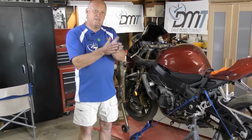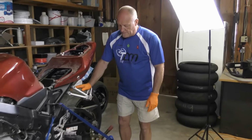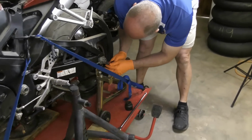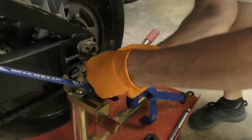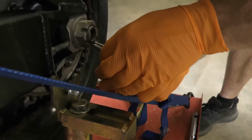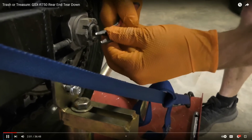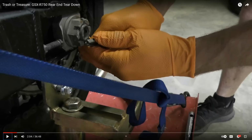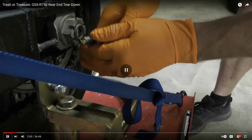Let's get this thing into pieces. All right, first job, split pin out. The tab's bent over, so we need to go ahead and pull that tab straight. He's got his marigolds on. Are they the shittest pliers you've ever seen? Don't use pliers. Use side cutters. Big chunky side cutters that just work better. The edges can get in there cleaner. And you're not trying to cut it, you're just trying to squeeze it. And you will squeeze those two legs together before you cut through them.